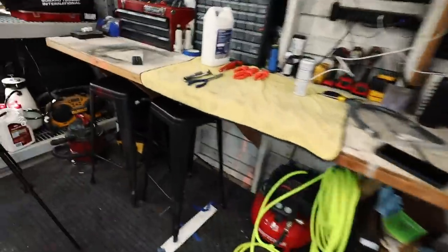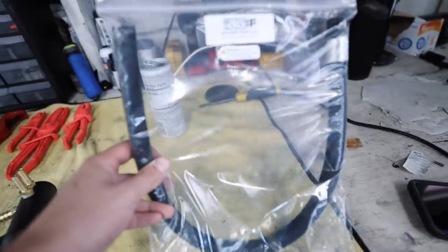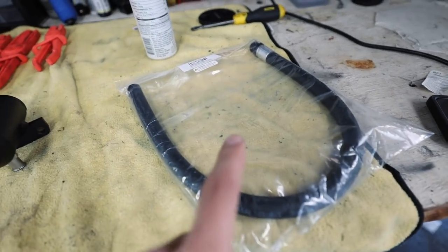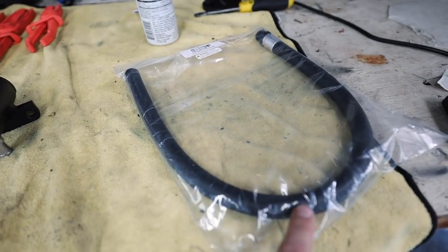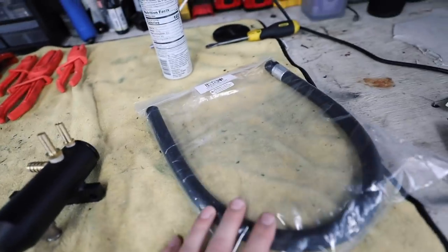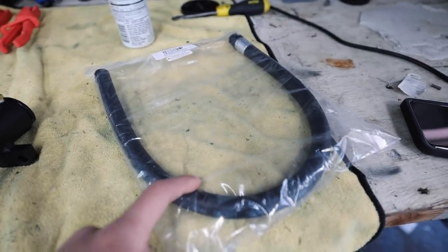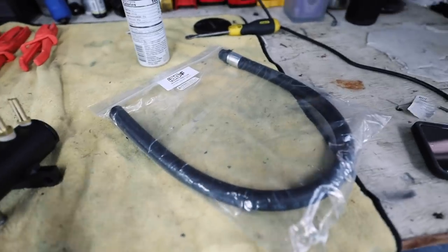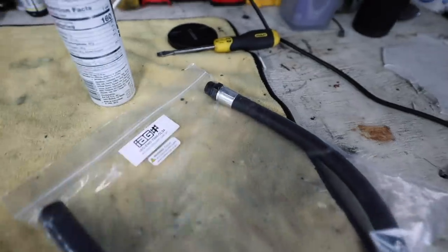When I said that this was my second time shooting this video, this was the reason why. If you have an IAG air oil separator and your hose coming off of the air oil separator to the upper coolant expansion tank, the OEM one, is trimmed too short, you're not gonna be able to reach this guy. So if you are looking at snagging one of these, make sure that you at least get a replacement hose from IAG. These things are cheap. I think it was $10. It was 2-day shipping. I think with shipping it was maybe 18 bucks, but worth it. It'll be easy to swap on. It's just that one fitting to get it on and off the air oil separator.